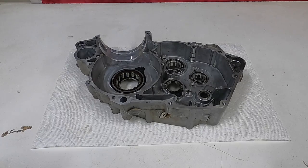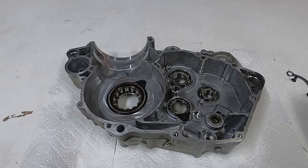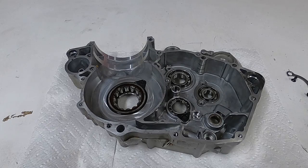The way this happened was I actually got sand into the engine from the crankcase vent, but I have another video on that so I'll put a card up. This will be a pretty in-depth and detailed video so stay tuned for the step-by-step process. The first thing I'm going to do is finish these bearings that I just pressed in — I have to put the retaining clips on and screw them down. They are a T25 Torx and I'm going to use blue thread locker.